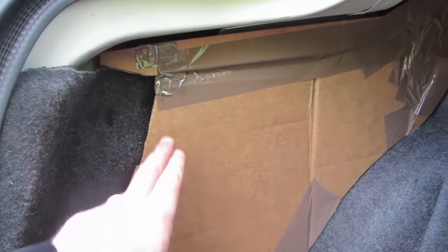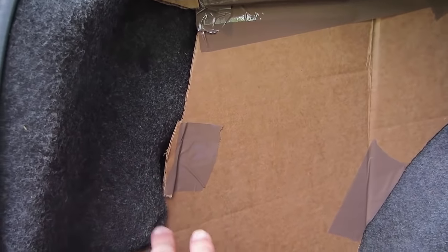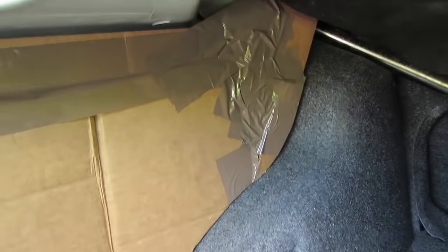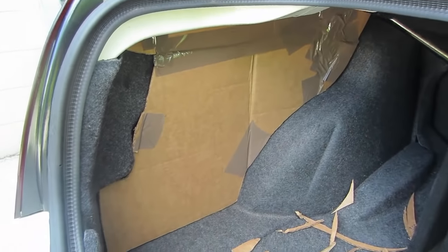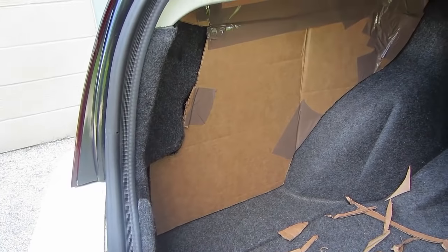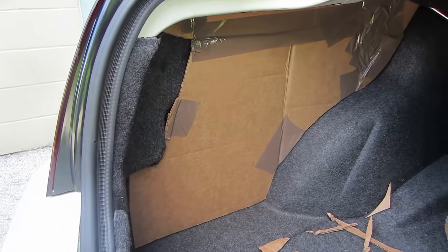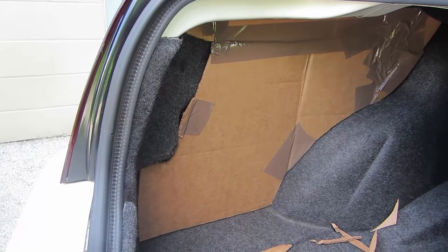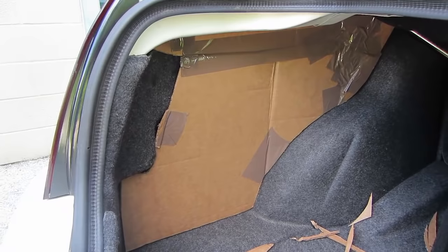At this point you can see I've got this piece of cardboard template pretty well defined around all these edges. I'm going to tweak all these a little bit. The bottom is nice and level, around the wheel well looks real good, it goes all the way up and hidden on the top. So all I have to do now is take this template out, transfer it onto a piece of wood, rip out a rough shape, and then I can trace out the template for the amp where it's going to mount. This piece here is going to actually be held in by pressure — I could add a couple screws or Velcro, but for the most part this piece will be self-sufficient when it's all done. So now let's go to the wood shop and cut some wood.